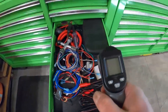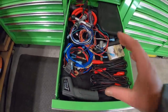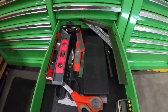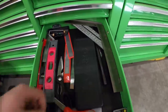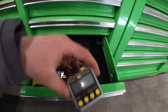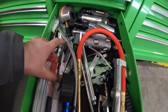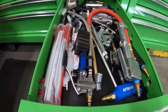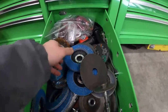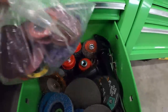I have a laser thermometer - this thing is great if you have any misfires, you can check the heat on the headers or manifolds to see where the misfire is coming from. Then this is kind of a measurement drawer - I use these all the time for laying things out, bolt holes and circles, stuff I need to cut. Got an angle finder I use for tube work or other random stuff. This drawer has my sawzall blades, air tools, and tire chucks. The bottom one is full of cutting discs, a couple of angle grinders, and my wire wheels in the back.